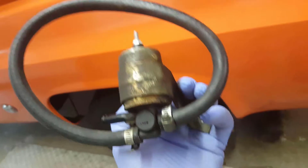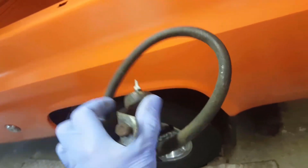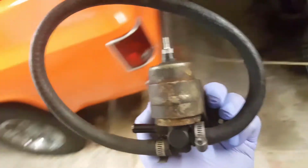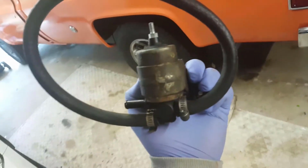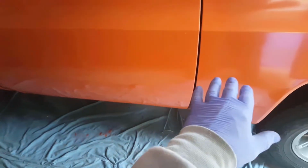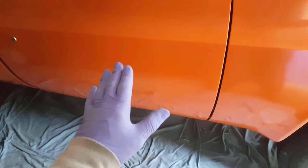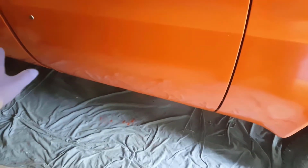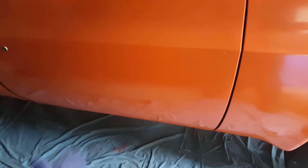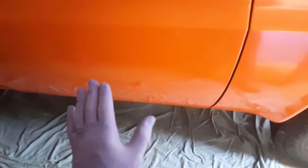That's old fuel hose, so it's probably been like that for years. So there you go. I'll test that, but that's another issue. That's now about both fuel tanks and the fuel switch. But the fuel delivery problem is solved. Another important thing to consider here is the metal line running from about there to there has been cut out of it, so the fuel hose goes all the way from the tank to the engine. So there could have been something a little bit clogged, or something a little bit iffy about the metal fuel line.